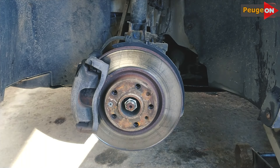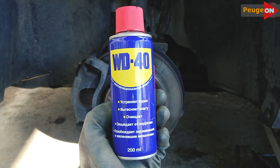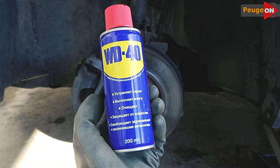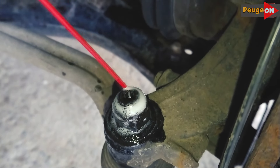All shots where you see leaks and similar issues weren't coincidental — the blame is all on the WD-40. If you plan to climb somewhere and unscrew something, apply WD-40 not five minutes before but ahead of time, at least a couple of hours, so that the lubricant has time to penetrate and start working.